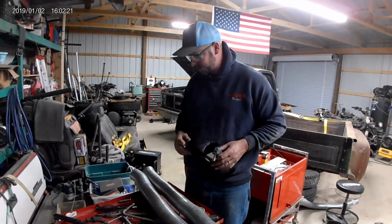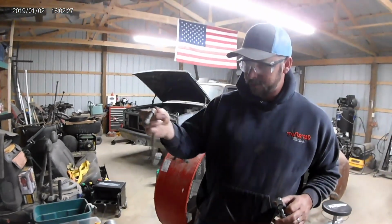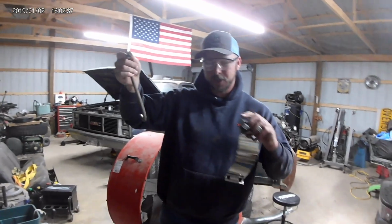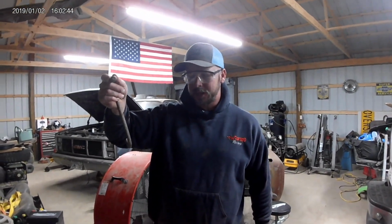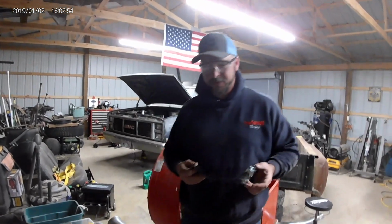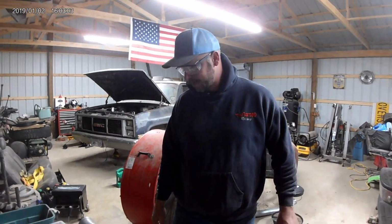Didn't work that way on one I was going to use on Wyatt's, but the exhaust hanger was in the way where we need to overlap our pipe underneath, but it was swinging backwards like that. So I think by cutting it, we can swing it forward and have it still hold the one pipe. It was only attached to one because the two were attached to the muffler. So once we attach this to one side, we'll run a piece of strap or something across it to tie the two pipes together. So it'll still support both pipes. And then on the other end, both pipes Y back together, and they're both supported off one hanger anyway from the factory. So we're just trying to mimic what the factory did for support. So we'll get these under there, see if they're going to work or if we have to trim them up a little bit, and get some clamps on there and see if we can get them snugged down and go from there.